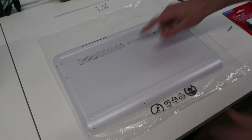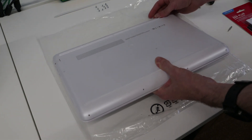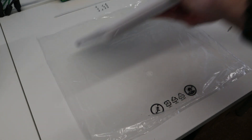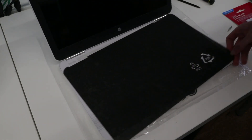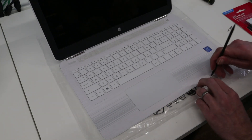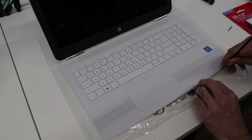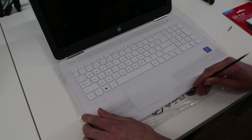Having gone to the effort of removing that little cover, there was nothing underneath it, so the service manual was at least correct on that even if the screws appear to have some variable sizing. What we need to do now is flip this over, take out the palm rest cover, and with our pry tool press down to begin separating the base from the palm rest.